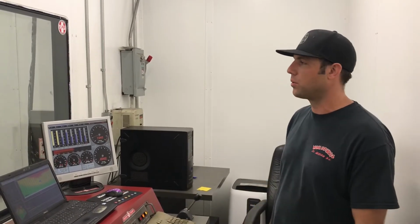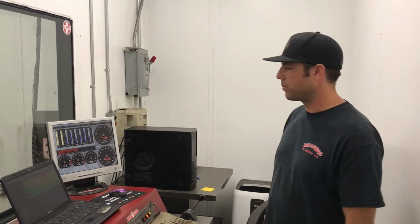Welcome back, guys. So we've got the 363 on the dyno with the small 216 duration cam. As Toby mentioned, this is a smog legal motor, and it's going to see some boost here. So we're just doing some NA runs with our AEM management system. The customer will be running the stock computer on it, or maybe even a Megasquirt, I'm not sure. Something to work with the factory Ford harness. So right now we're just doing some baseline runs, making sure everything is good, and he's got some numbers to go with.